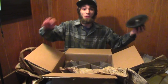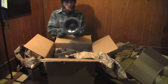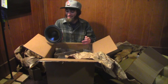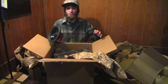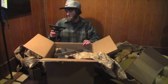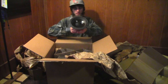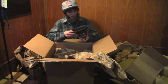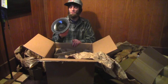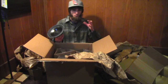I'm gonna have two different cabinets up at the front — battery died there, sorry. We're back now. So basically I was just giving you guys a rundown of the eights — really impressed with them so far. I can't wait to hook them up and see how they sound. I don't need to have my towers playing all the way down to 15–20 Hertz for those intense home theater moments, so that's why I chose to have these crossed over a little higher, tuned to a slightly higher frequency. Every time you double in frequency, that's the next octave up, so if I tune these around 50 Hertz, the next octave down is 25 Hertz — perfect for matching up with my other subs tuned roughly in that area.